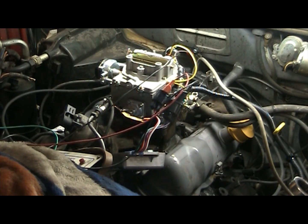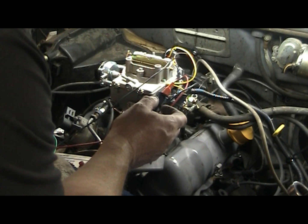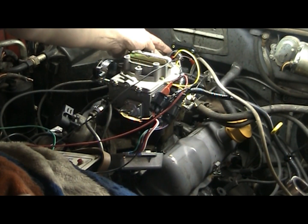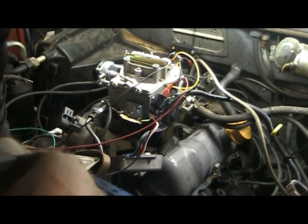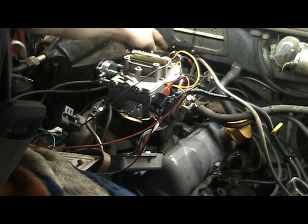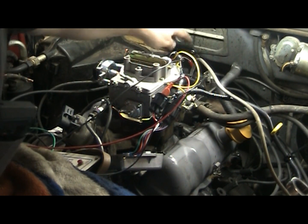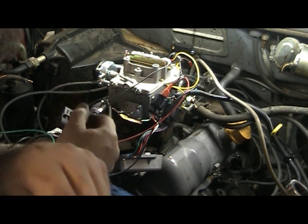Alright, so we've got a big old mess here. Let me tell you how I had to figure this out. We've got the DuraSpark distributor — it's a Bosch distributor back here. I ran the two wires into the side of the GM module, and I had power, and the other one was the coil negative, which is the switching circuit.